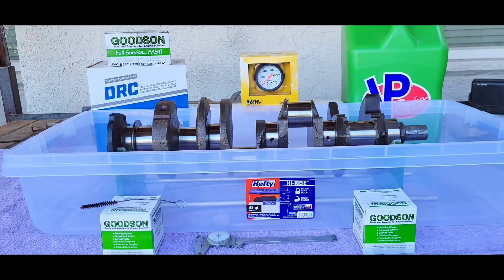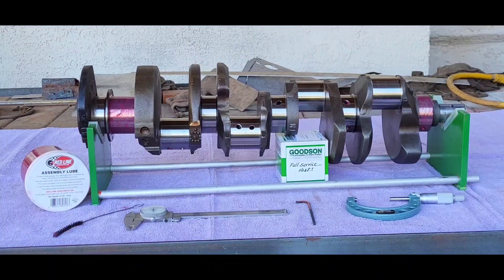We are prepping this crankshaft that was made in Mexico for the Target test motor. This is the original crank that came with the crate motor new. It's an ongoing test — we've chosen to use it and we have to determine if it's a good choice. First, we have to determine whether it is straight enough. We've lubed the number one and number five journals on the crank.